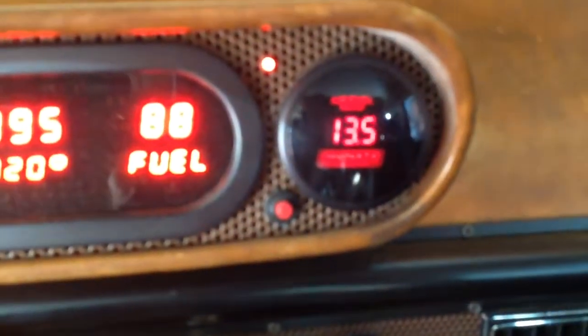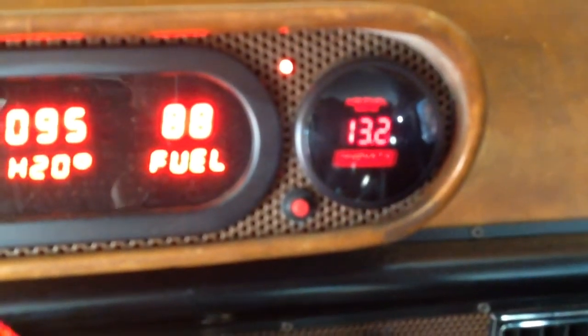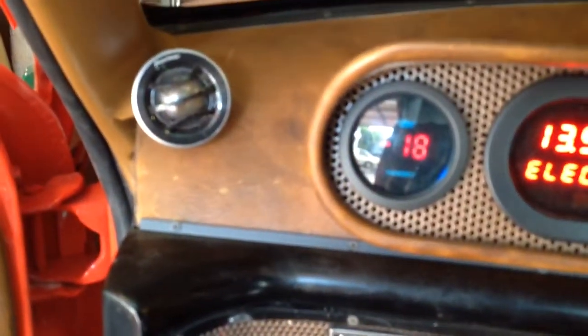Maybe we try to start the car. We're going to go up here to warm-up enrichment — that's what I want. I'm going to let it auto-tune the warm-up enrichment. Hopefully I'm doing all that crap right. We are running. Looks like it's hovering around a 14 to 1 AFR, and 18 inches of vacuum.